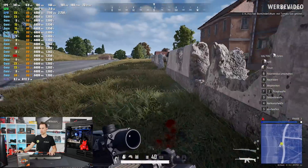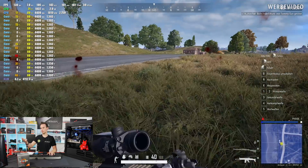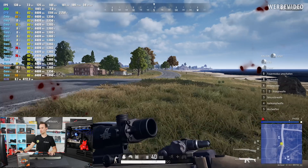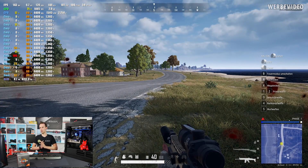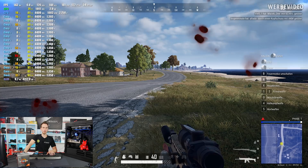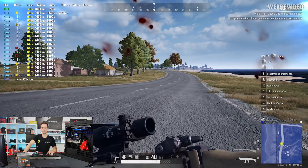This shows how much difference there is between Prime95 load testing — where temperatures are in the upper 80s — and in-game where it's currently 61°C, even under the exact same conditions of 4.4GHz at 1.36–1.37V. I won the silicon lottery with this 3800X, but I can recommend pretty much all the other components from what I've tested — nothing bad to say about any of them. Thanks for joining in, see you next time.